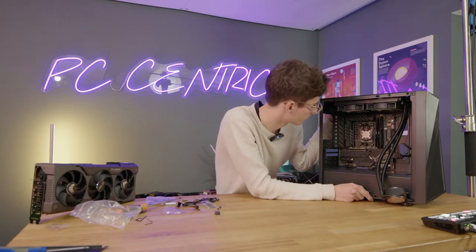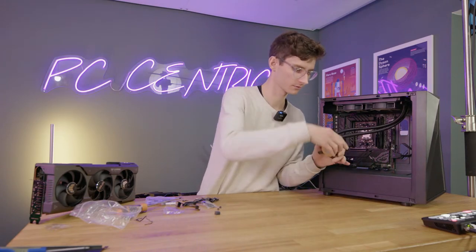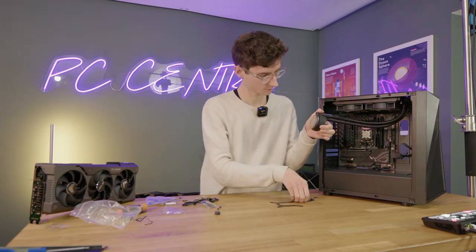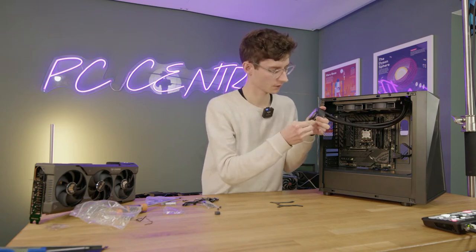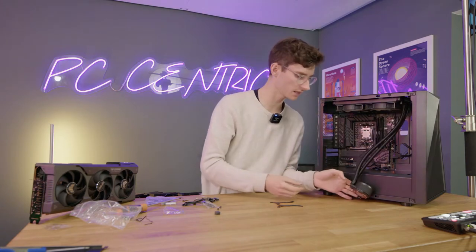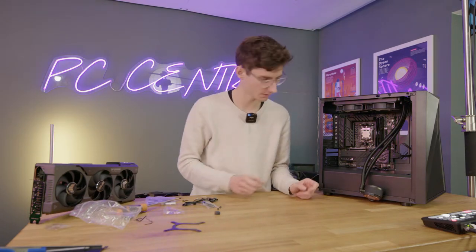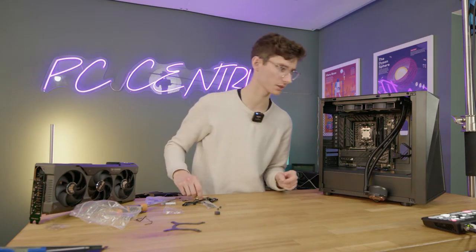We've got two more donations. Coral Freezy with 14 ZAR: what motherboard do you recommend for a Ryzen 5 5600G? Oh, 5600G? Yeah, one that you can update with USB BIOS flashback, because obviously that was a newer CPU. If you buy a really old off-the-shelf motherboard, it might not support it. And if you don't have USB BIOS flashback, you might not be able to get it working without a different CPU, which would be a bit of a pain.